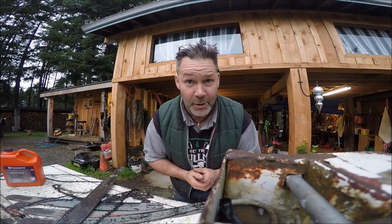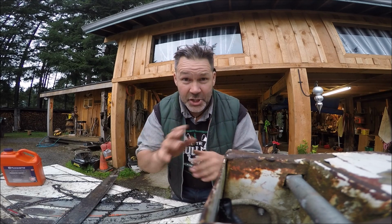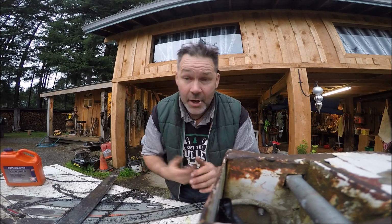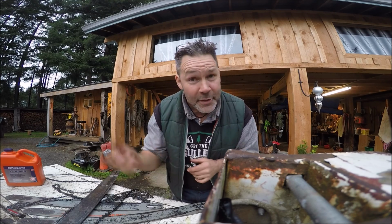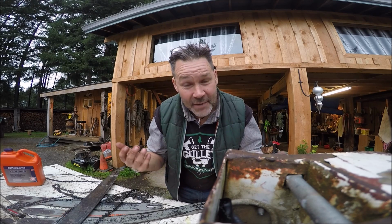Friends, I hope you enjoyed the video. I know it was a little whippity dippity snippety snappity, but you don't have to throw your bars away. Don't throw them away. Go to a thicker gauge chain when you're running 73 gauge and she starts to slop out a little side to side. You can squeeze your bar, but I go to a thicker gauge chain. Go to the next size chain up. Driver size, 73, 75 would be the next.